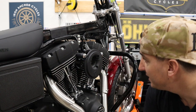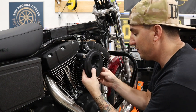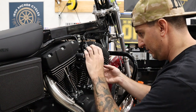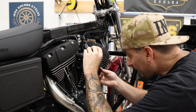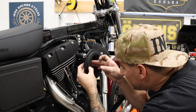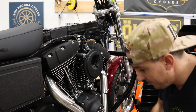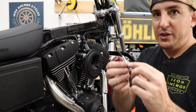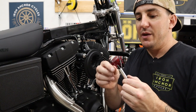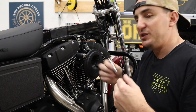So the next thing to do is line up our gasket here and I'm going to slide that in from the back side. Okay. And just making sure we got all the bolt holes lined up. Okay. Now, this comes with these standoffs that have studs in them that need to be screwed into it. We've done that already, and we red Loctited the stud into the standoff, and we've got blue Loctite on the other side of it to go in here.